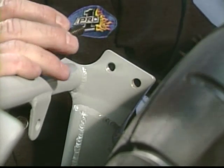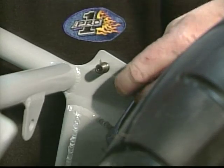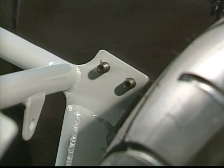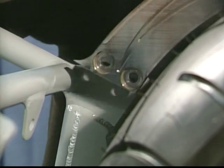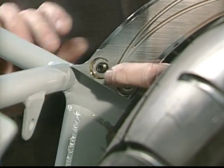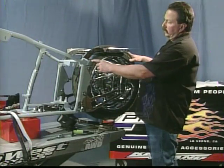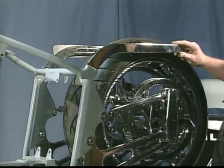The small studs are inserted from the inside of the frame at the rear. The never-seize was installed and you just screw them in by hand — there's no need to tighten them up at this point. I'm going to reach over and grab the fender strut. The fender strut just simply slips over, and the two nuts will follow. We've installed the opposite fender strut — same procedure as the other side. We've got it snugged up; we don't have it tight, but we don't want it to move around.